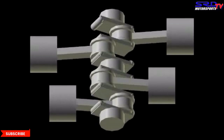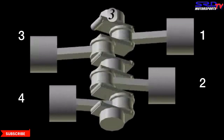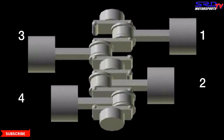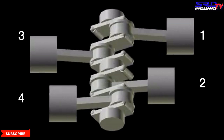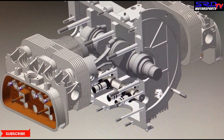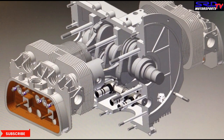Boxer engines are not exempt. Here's an example — a VW Beetle boxer engine with pistons one, two on one side and three, four on the other. As pistons one and two go to top dead center, they pull air from the rear from three and four, and when three and four go up to top dead center they push it back. It's like pushing air back and forth, and as RPM goes up this gets heavier and harder for the engine to turn. This is why ventilation is important. Even in the Subaru flat-four it has the same potential issues.